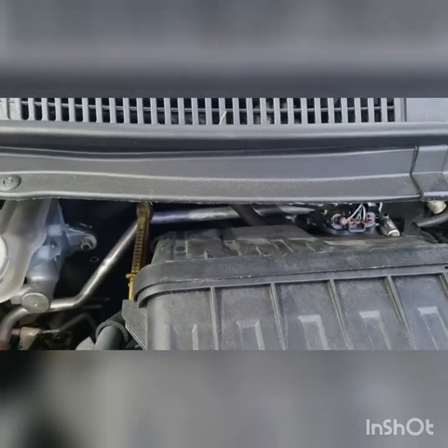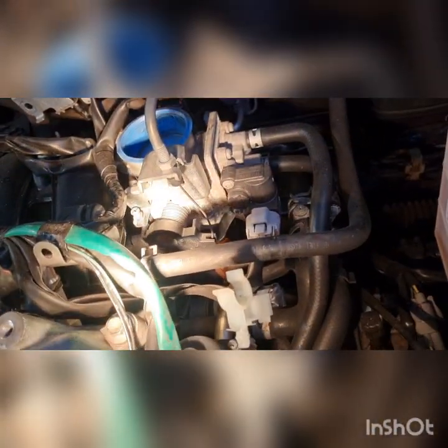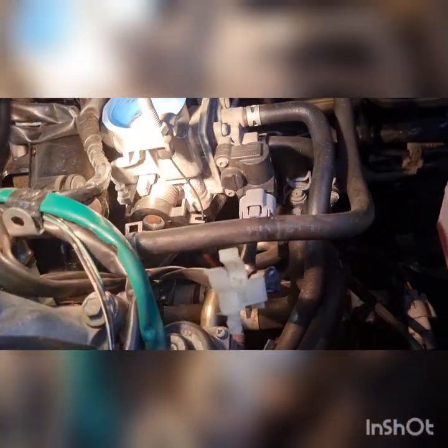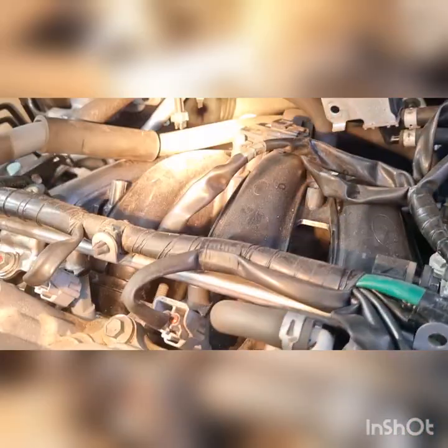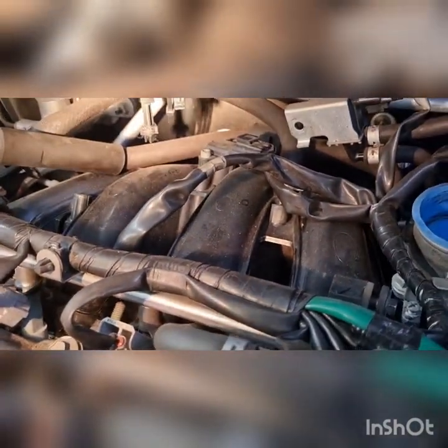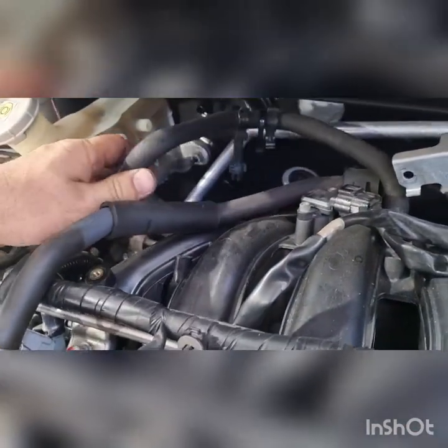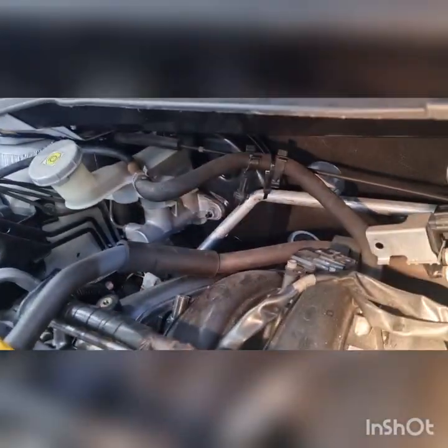I'll grab the smoke tester. Righto, so, a small leak from the throttle actuator. Not really a big deal, I always see those seals leaking a lot of the time. That noise that you can hear is like the pressure relief valve in the smoke machine anyway. So that's usual, but why is that? Oh, it's kinked over. Maybe it was kinked.